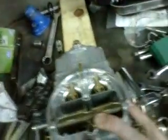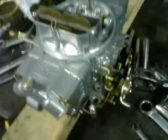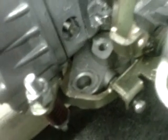And in that sense, flip it over again, you would have to adjust your secondary throttle blades, open them up a little bit more, and there's this little screw right there, and that'll open them up. And you got to pull the carburetor off to adjust that, unfortunately, on a Holley. I believe Quick Fuel sells a part that you can adjust that screw over there without taking the carb off. But anyway, so that's kind of your carb idle screw adjustment.